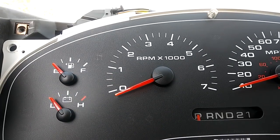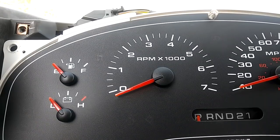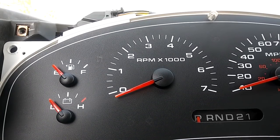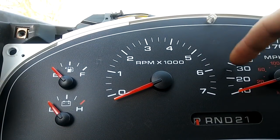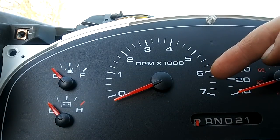Then shut it back off. You're gonna have to sit and wait a few seconds, but all the gauges will move — it'll all move back down to their stepper motor stop point, and then it'll come back up to zero and calibrate itself.